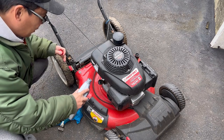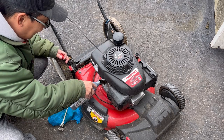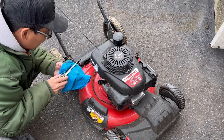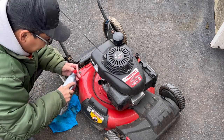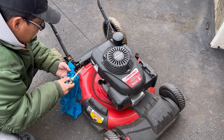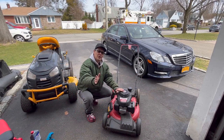I've got some of this Lucas oil. I don't need to push them anymore because I'm no longer sponsored. But nevertheless, I'm still gonna fill it to about the threads. It only takes about 10 ounces for lawnmower engines, typically, at least for the Briggs & Stratton kinds. I don't know if that was 10 ounces, but it seems to be all the way down. Yep, needs more. Perfect. A little bit over the line. It's good. All right, fellas, so we got oil in there now.